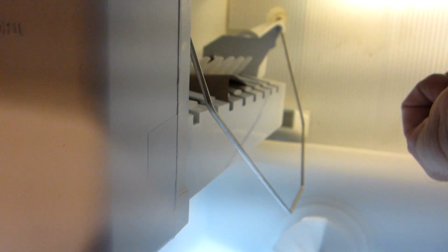To make repairs, first of all, you have to remove the cover, and you can use a thin screwdriver for helping to get it started. Pop off the cover. And with that done, the next thing you need to do is to pull the arm out from the back of the module. So put the arm in the up position and push with one finger and pull with the other till that comes loose. The next step will be to remove these three screws with a Phillips screwdriver. Okay, the three screws have been removed, and I simply grab the module and pull it straight back out.